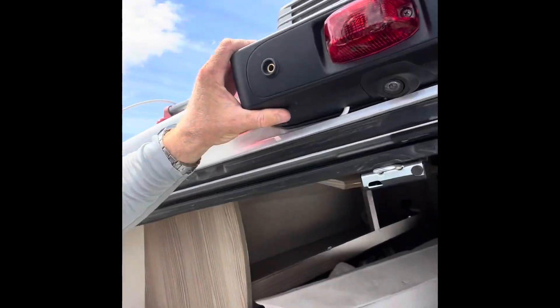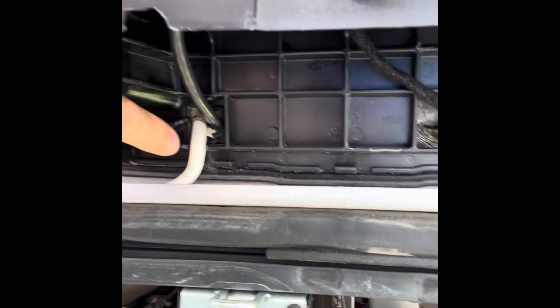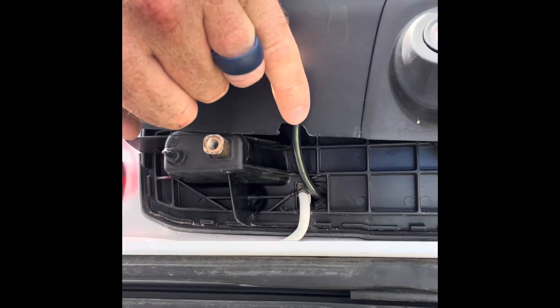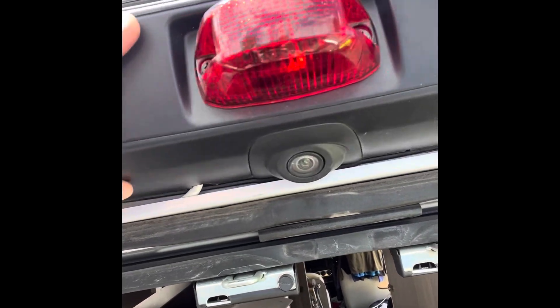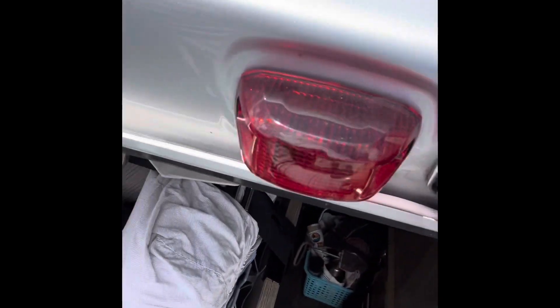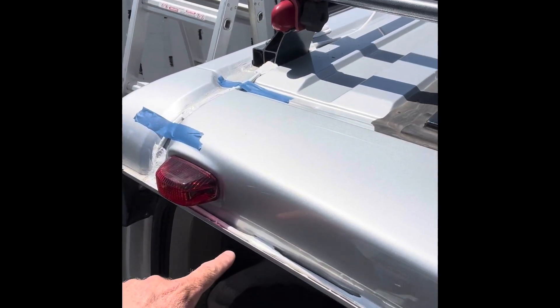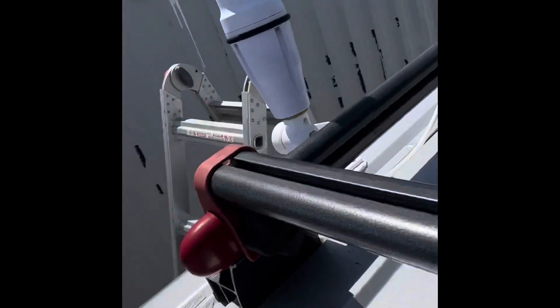It's relatively easy to pass the wire from the inside through those holes and then out through the back. Here's the light — there's the camera and the rear light. The white cable passes out, and I did notch right here just with a knife — it cuts really easily. I notched out the plastic because this ridge runs along, so the wire can sit down in there. I also notched out the bottom of the light right here — just scraped away with a knife blade — so the light can sit in there cleanly. I'll get the screws back in and it will be secure. I've used a little bit of sealant down here to pin the wire down; once that dries I'll add a bit more. From down below it's almost invisible.